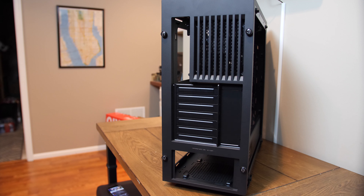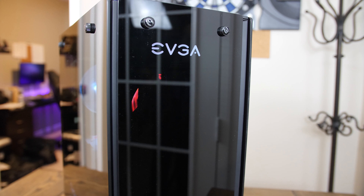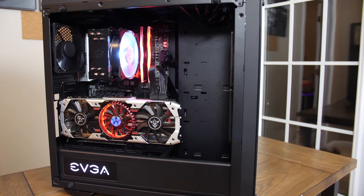Moving around back, we see a strange plastic cover secured by thumbscrews. Why is this here? It makes getting to your components take an extra step and provides nothing aesthetically — how often is the rear side of your tower on display? Literally never. The front of the case looks nice and I like how the glass was used here, but I did have some major concerns about airflow, as the only space that isn't completely sealed up is the right edge. Luckily, airflow wasn't quite as much of an issue as I feared. My test system ran an 8600K overclocked to 4.7GHz using only a Cooler Master MA410P tower cooler, and temps maxed out at 62°C under load. I removed the front panel entirely and re-ran my stress test, with temps only dropping down to 58°C. Four degrees isn't insignificant, but the pathway is at least moderately effective, which is a relief.